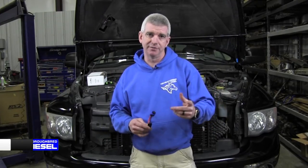For a couple of different applications, that's not going to work. For you guys that have got performance chargers on your truck, you are already looking for a higher boost number capability. And for you stock guys — if you're towing and you start creeping up on that 32, 33, 34 PSI, especially while towing uphill, the truck's going to be in a little bit of a strain. You need to maintain that boost so you can keep the EGTs under control. That's where the Boost Fooler is going to come into play.